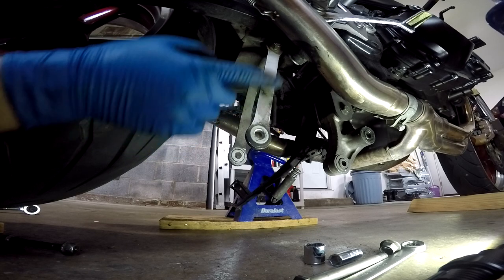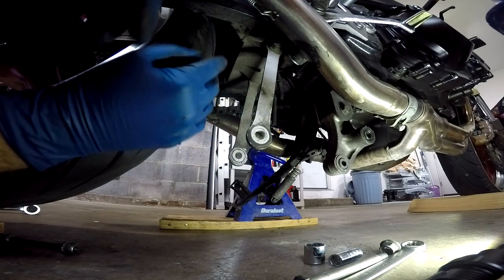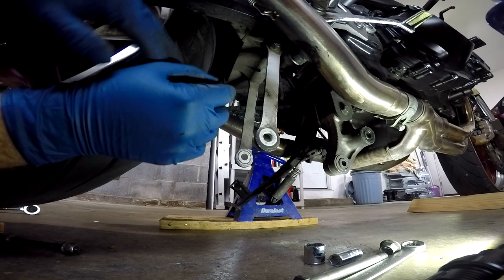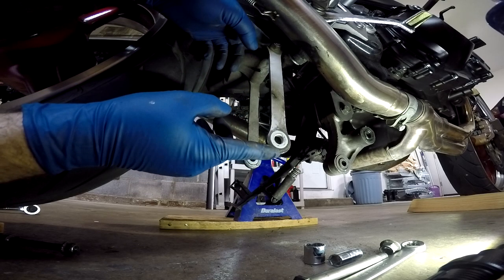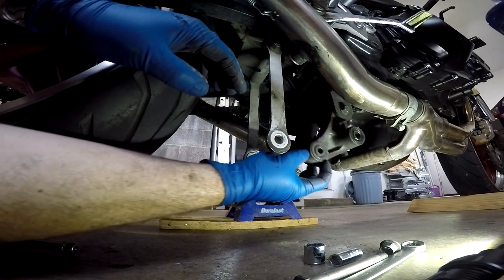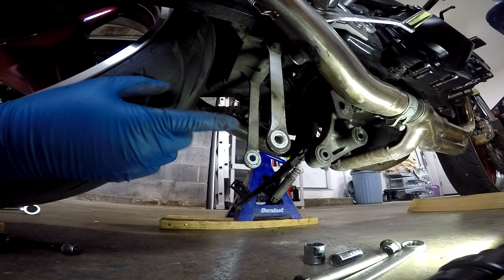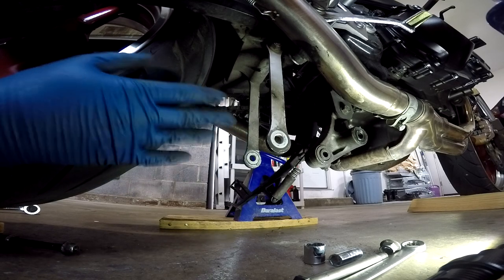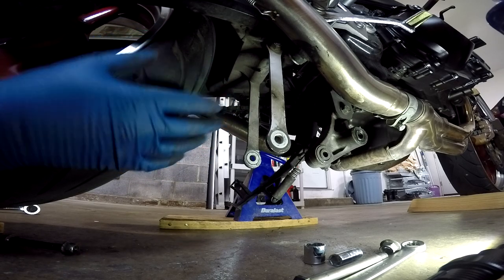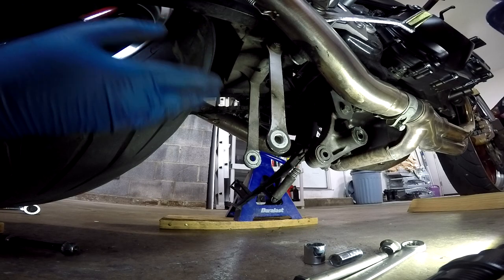While we're here, I'll take the opportunity to talk a little about the dog bones. If you've ever heard someone talk about lowering links, this is what they're talking about. If you ever need a bike lowered an inch — or in some cases raised an inch — you're actually changing these. In order to raise or lower the bike's height, you get a different set that are either longer or shorter. All it does is change the set height of the pivot where the shock is bolted to. This bike, when I bought it, the previous rider was a tall guy, the Gen 1 Z's had a very low seat height, so he actually raised the bike an inch in the back because he liked it better that way.